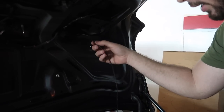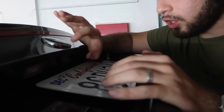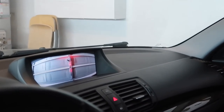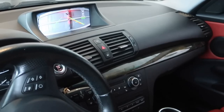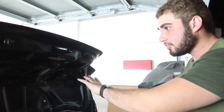The next goal is to fish the wire around and get it through here. Now that we have the wire coming out right here, the next step is to remove the old one, disconnect everything, insert our new camera, and wrap the cables down here to connect somewhere back there. Oh, and it works! If we click the button, it is working. So at this point I'm just curious if the camera works - let's leave it towards the roof, go in the car, put it in reverse. That is so satisfying - everything is properly wired! This is such a good result right here. We deserve some ice cream tonight.